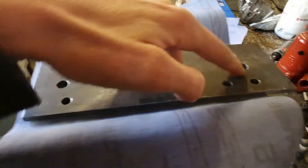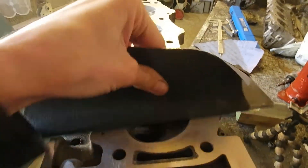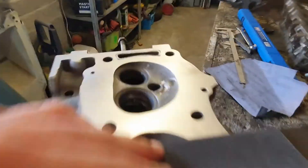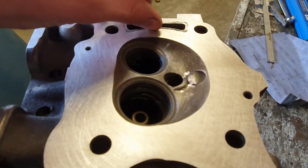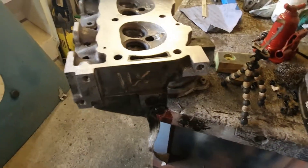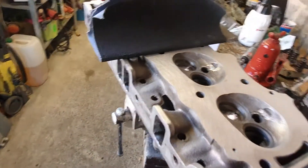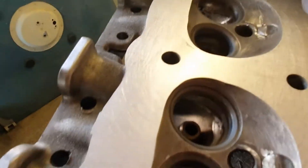Here I am — I've done quite a bit of sanding. I've got a very coarse bit of emery cloth to start with and a flat sheet of steel — the same piece I use to cover the water pump holes on the block. I'm rotating it so the sheet always covers the head side to side, which keeps it flat, and keeping it flat the other way by sanding evenly — I keep checking with my straight edge. I'm nearly there — this damage is nearly gone and that damage is very nearly gone, this was the worst of it. I can still feel it with my nail but only very slightly now. At the moment I'm still within spec — there's about 0.05 to 0.1 mm left to take off before I go out of spec. That was last night; I got pretty tired doing it, so I'm carrying on now and hopefully I can reuse this head, since I've already ground the valves in and ported them.